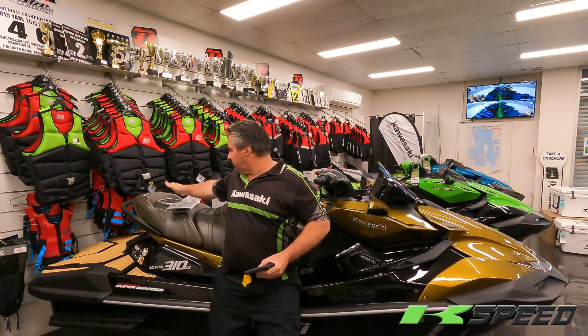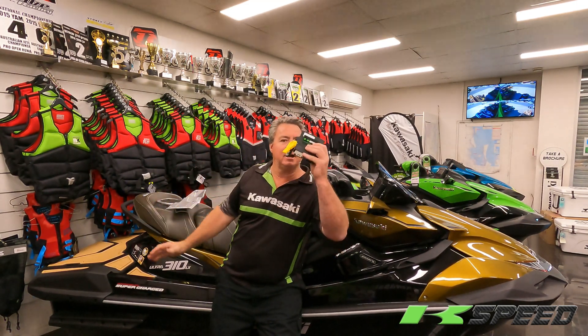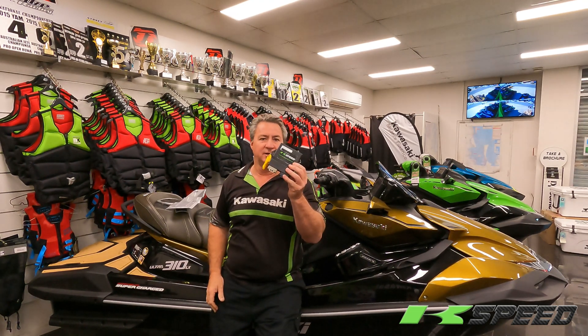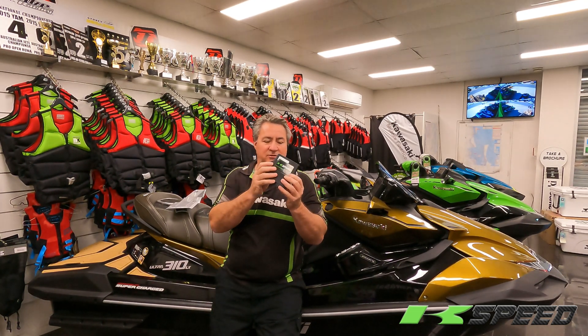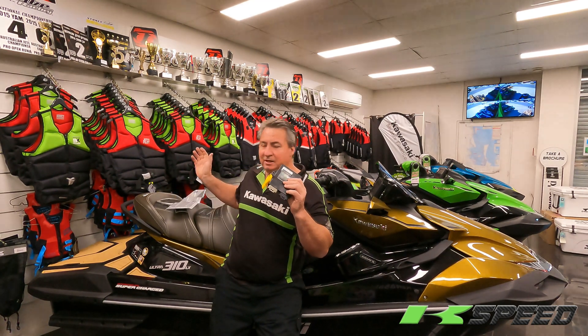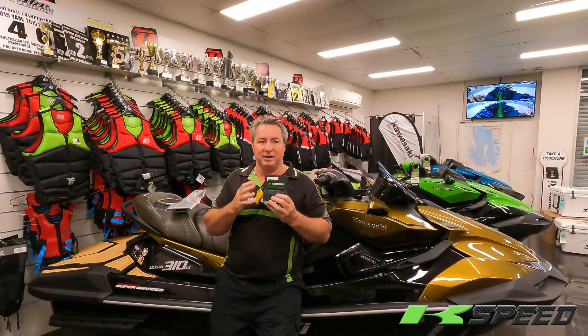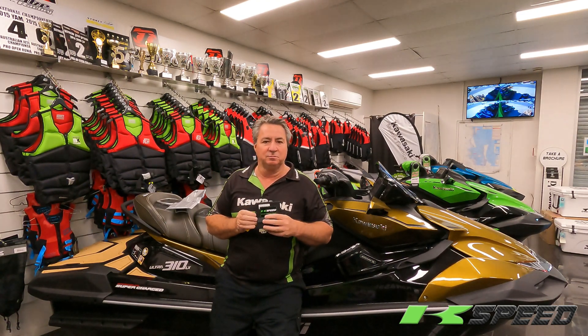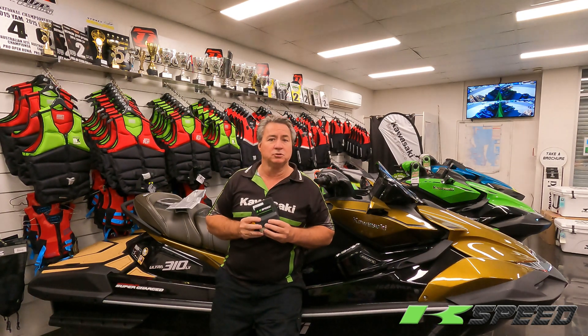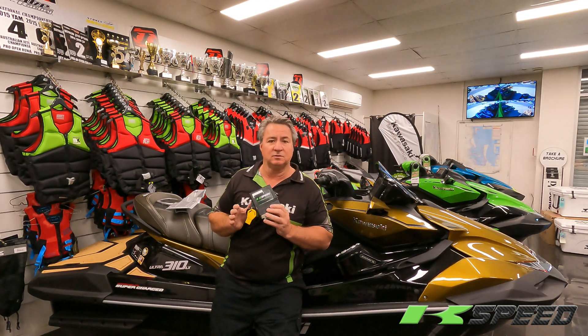So the stage one — those are the parts: you've got the pump wedge and the intake grate. It was a reflash service, so you would post your ECU down to us here in Australia, I would reflash it and send the kit back to you. This would take about 10 to 14 days without your ski — still available, still business as usual, same as we've been doing for the last 12 years.